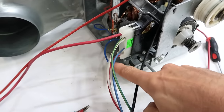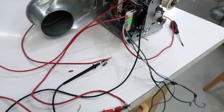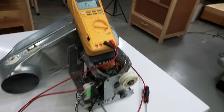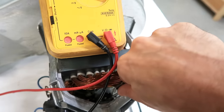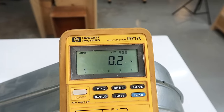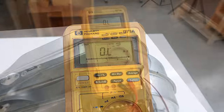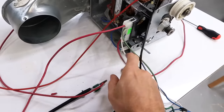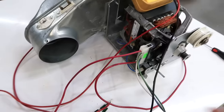These two red wires I'm pretty sure are for turning on the heater, because they're the really thick ones. I've hooked up my multimeter to those, and right now that shows no connection. But if the motor starts, this switch would go this way — and now it shows connected. If I let go of that, once again, infinite ohms. So that tells me these red wires are just for turning the heater on and off, and they're really not needed just for running the motor.